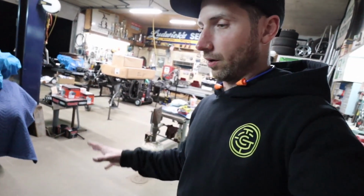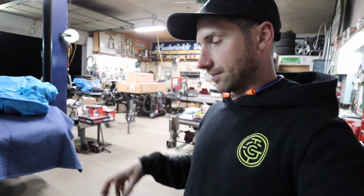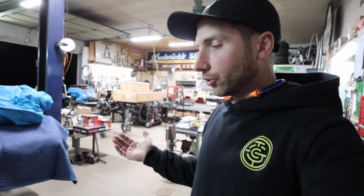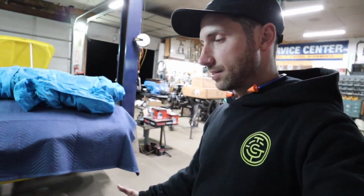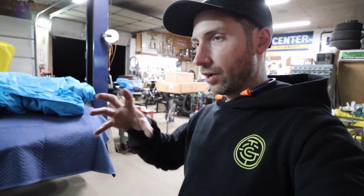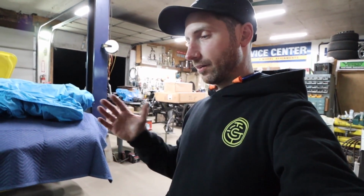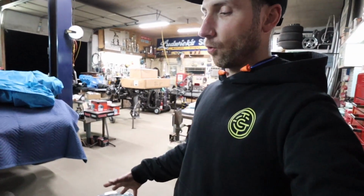But the overall goal of this type of stretch, in my opinion, for this particular application, isn't just stancy stance. It's so I can get the car as low as possible and still have as much steering as possible. So the more tire stretch I have, the more bevel of the sidewall I have, which is ultimately where we saw this originate in Japan. I mean, I guess you can't really say where it originated, but we saw this in the early 2000s, late 90s in Japan, and a lot of those cars were static, and the stretch tire allowed for not only a smaller overall diameter for ride height, but it allowed you to run a pretty wide, aggressive wheel, but still have your steering. But if you had any sort of balloon tire or a tire that was wide enough to where the sidewall was straight up, you'd buzz your fenders if you were trying to steer on a static low car. So that's kind of the overall idea for this.